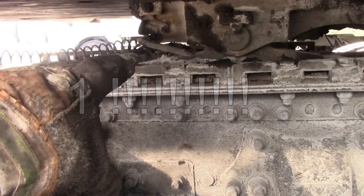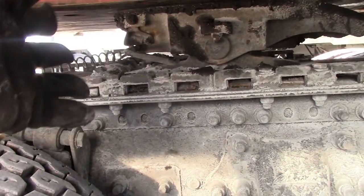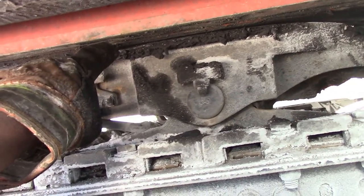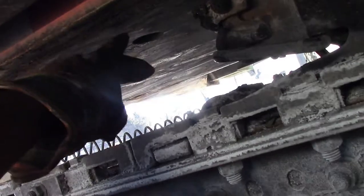That's the fifth wheel arm. Make sure that's pushed in, to show that it actually connected to something. And make sure there's no space between the fifth wheel plate and the, what they call that, the apron? Yeah, they call it the apron, I think. This right here. It's an apron. Make sure there's no space between that.